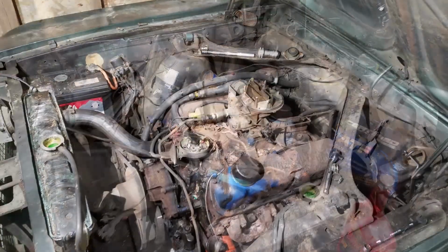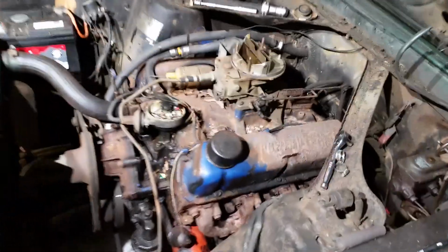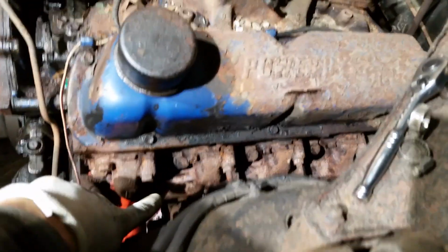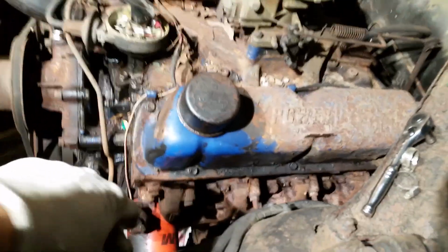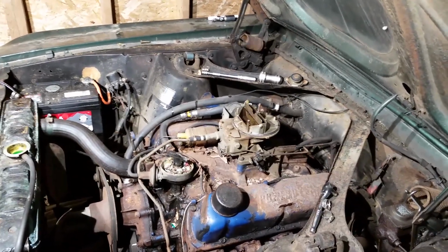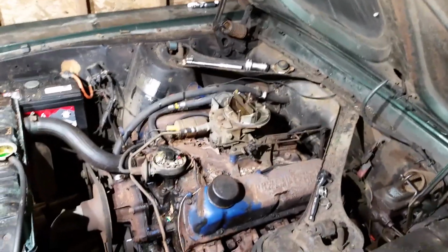just to kind of help those rings out a little bit. Unfortunately, the camera died when I started fogging all the cylinders, but you can see a little residue on the exhaust manifolds. So all the cylinders are sprayed, some ATF and a little bit of Marvel Mystery Oil mixture. So hopefully that works out.